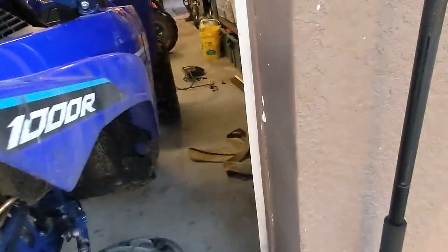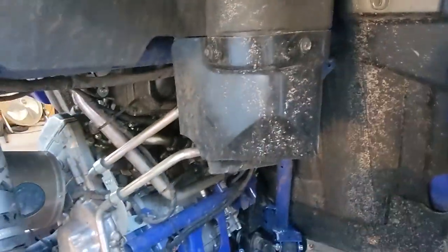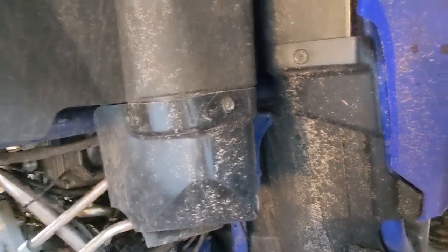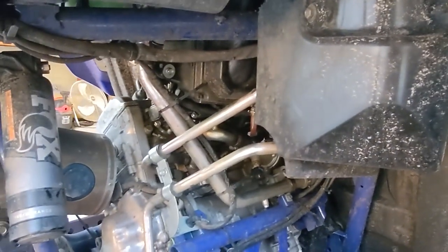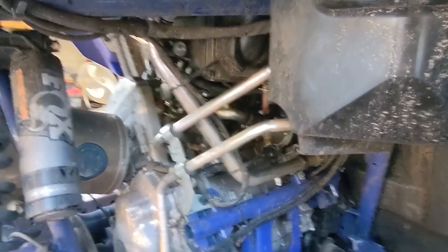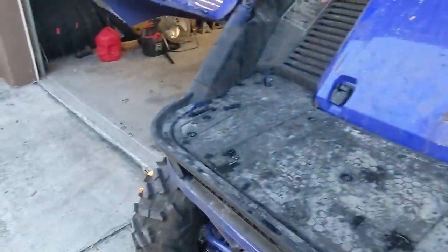I did have a check engine light when I first fired it up. It turns out you do have to have this little solenoid piece plugged in from the canister air injection system, so I just plugged it in and zip tied it right there for now. I'll probably eventually tuck it up where you can't see it. Looks like I got the throttle body back in there correctly, and it runs great — no throttle hang whatsoever. It snaps right back down to the correct RPM.